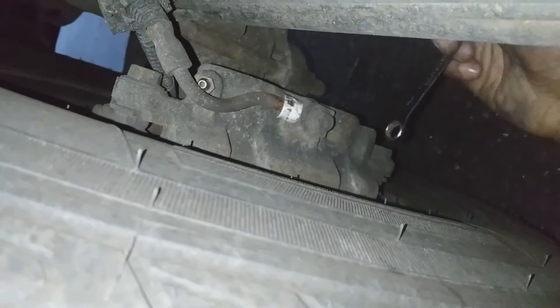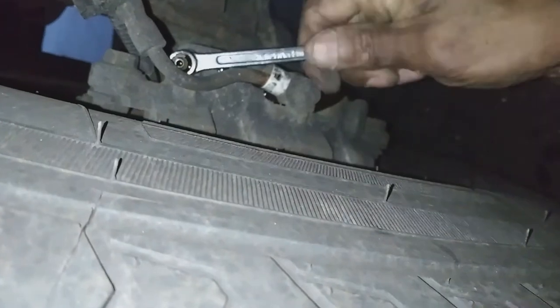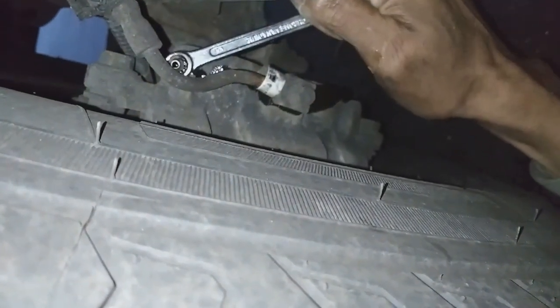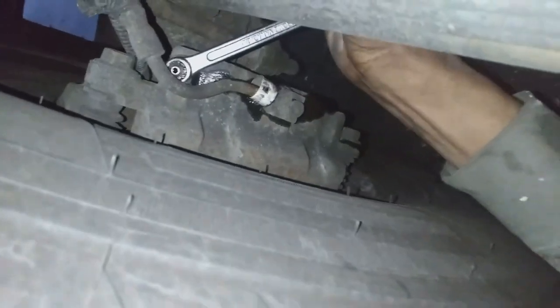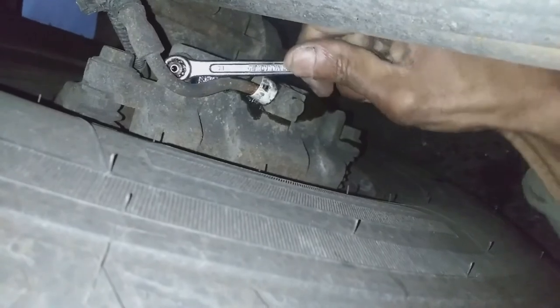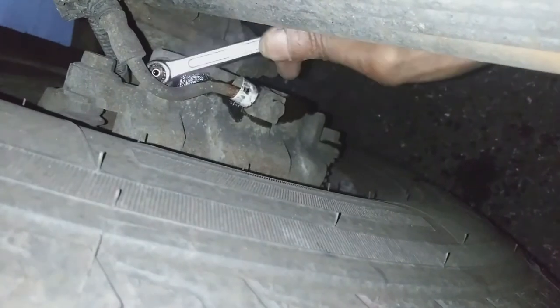It's a little rubber cap to prevent water and dirt from getting down inside of the bleeder nipple. Without that cover on there, water getting in these things will rust them and lock them up. So you want to open it and make sure there's no air. What I did, I went back and pumped again and rejammed the brake pedal and came back. Okay, that's a better, higher pressure, so I'm comfortable with that pressure there.